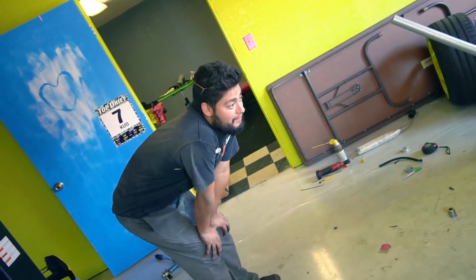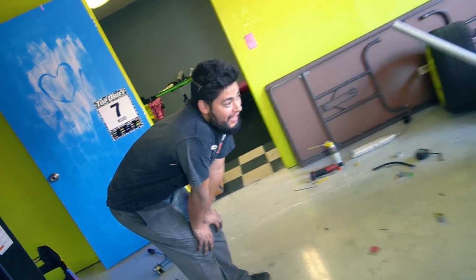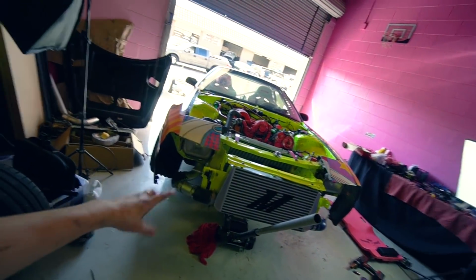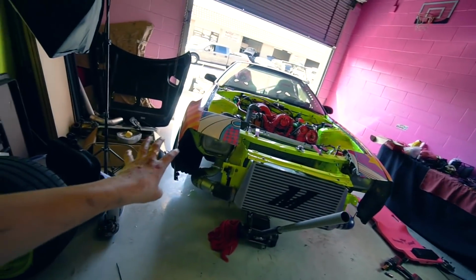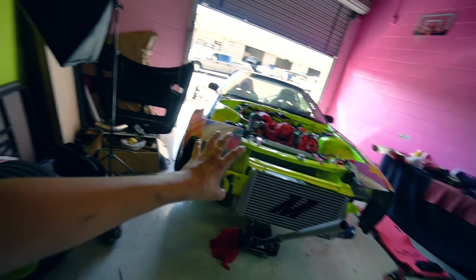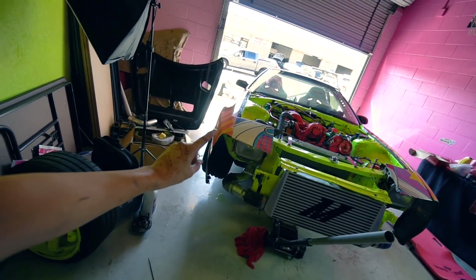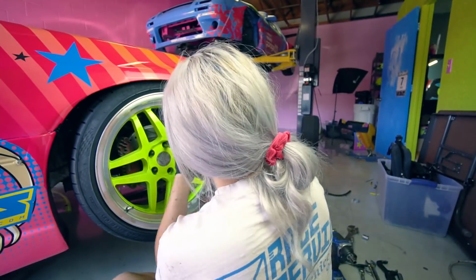Damn. What do you know about that low life, Jippy? As low as my standards. This is insane. Yes, it worked. So with a total of 14 millimeters of spacers, we clear the coilovers. I'm gonna get the other side of the angle kit finished and installed, so that both sides are at the same point. We know the size of spacer that we need for this side as well. I'm also gonna swap on the oversized studs here, and then we'll do fitment from there.